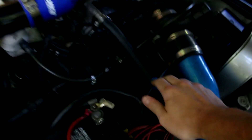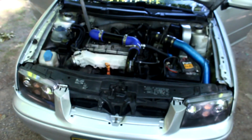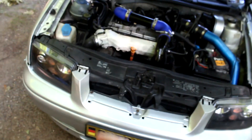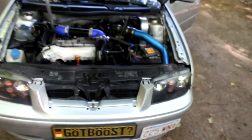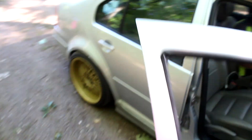You run two wires off the switch, and down here is your vehicle speed sensor. There are three wires and what you want to do is tap into the ground. What you do is basically shut the speed signal off. In a lot of tunes, in order to hit the rev limiter or start with launch control, the tune needs to know that the vehicle has stopped — which means the vehicle speed is zero. So what you want to do is cut the ground, run a switch to the ground to turn it on and off. While you're driving, you can two-step or use any launch control or whatever rev limiter your car is set up at.